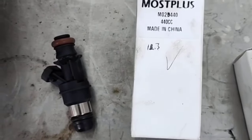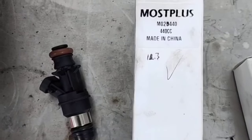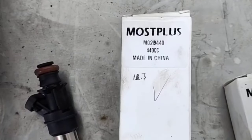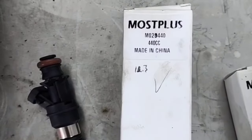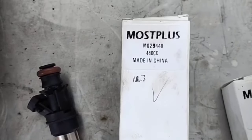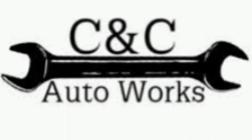A few moments later — well, I guess you get what you pay for. We paid $50 for these injectors and gotten about 50 miles out of them before they started getting really erratic AFR, jumping all the way from 17 all the way to the commanded 14. Don't buy these. Save yourself time and money. Thanks for watching and we'll catch you next time.